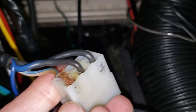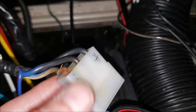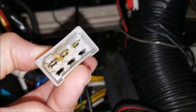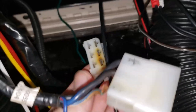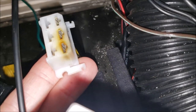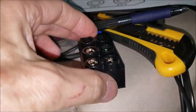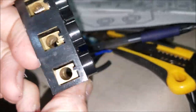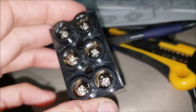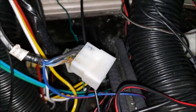You can see there's already a strand broken, maybe two. I've got an idea — I'm going to eliminate this spade connector altogether. You can see it got hot down in there, and this one really got hot. I've got a connector I think is rated for 60 amps, with nice big brass bronze connections. Let's get to working on that and I'll show you how I'm going to correct this problem.